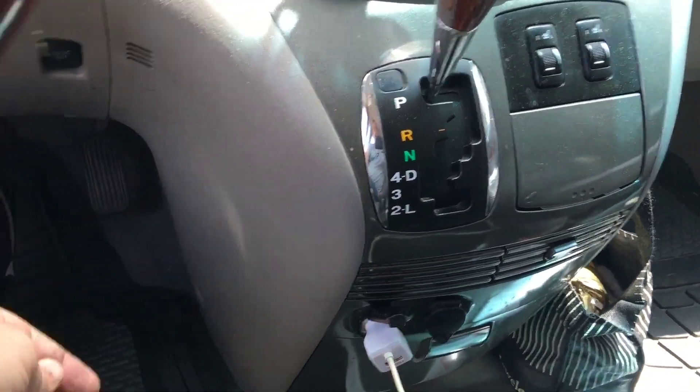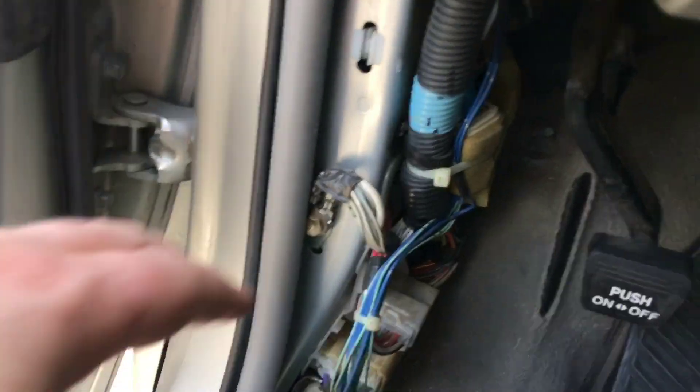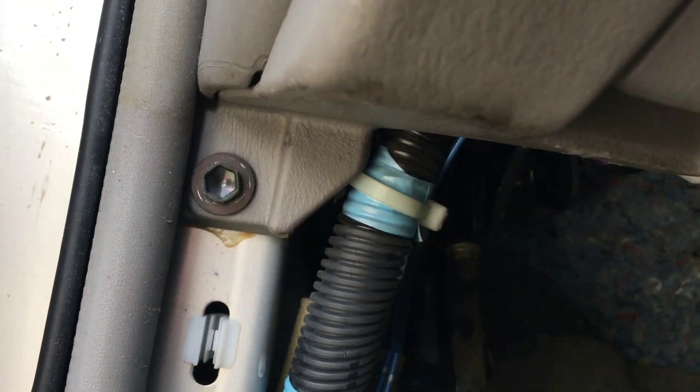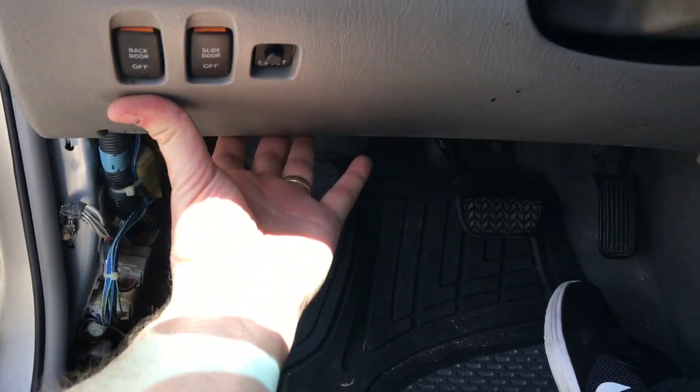The first thing I've done is taking that plastic fastener off, taking the screw out with a 10 millimeter socket, and I'm gonna take this panel off. Second step — taking this panel off right here. You have a nut, same 10 millimeter socket, and then I just popped it straight up so that I can access this bolt. Looks like I'm gonna have to drop this panel down. With the second bolt taken out, I can just pull this panel and it just easily pops right off.